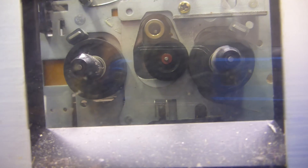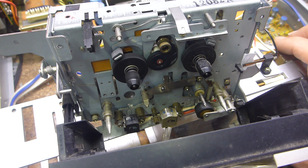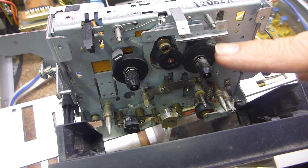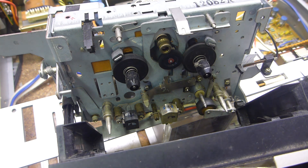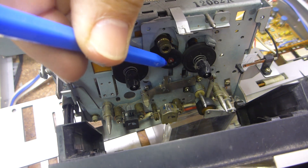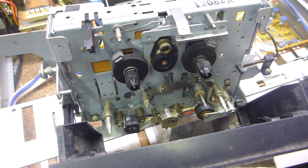There's a little breaker switch here - if I break the contact, I now have access to all the transport functions. We've got reverse, though it doesn't seem to want to play for very long. Press stop, fast forward goes the other way, and I could stop that very easily. This little wheel just does not have enough clutch power. Press play again - you can see it's trying to drive that capstan wheel. If I pull that over, it puts a bit more force on and it seems a lot happier. I'd say this little wheel here is the problem.